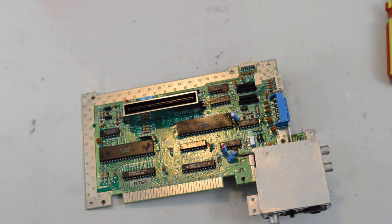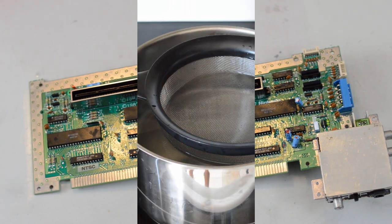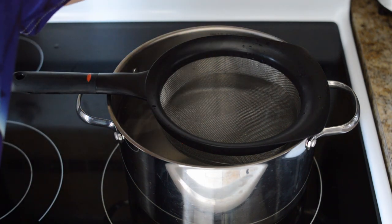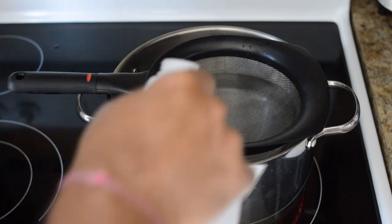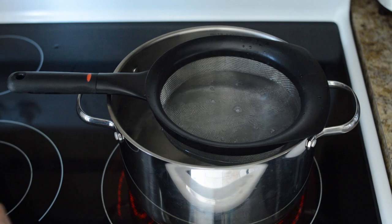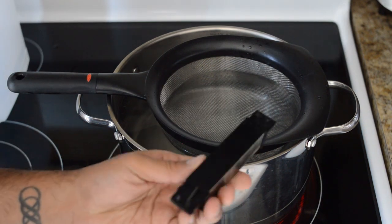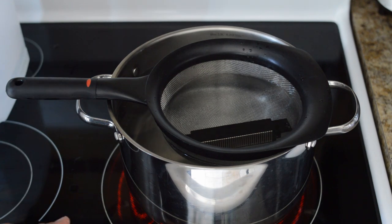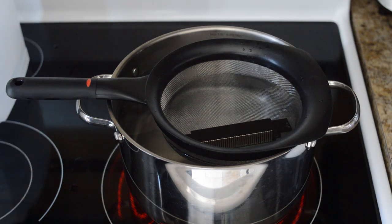I'm going to clean the shell and then we're going to boil the 72-pin connector — then we reassemble the NES and hopefully have a working one. Here we are, ready to boil the 72-pin connector. I have a pot of hot water — it's not boiling yet but we're going to get it going. All you're going to do is put a splash of vinegar in the water; this is going to help remove any corrosion on the 72-pin connector. I'm using a strainer to make sure the pin doesn't contact the bottom of the pot, because you can get hot spots at the bottom and actually melt the plastic or damage the connector. Submerge the connector, make sure it's all the way in the water, and once the water is boiling wait about 10 to 15 minutes. Pull out your pin, let it dry off and cool down, and then we're ready to put it back in the Nintendo.